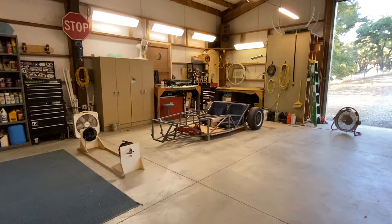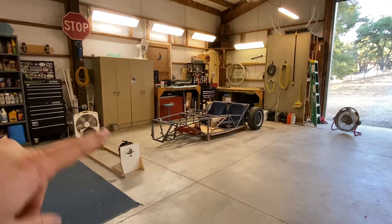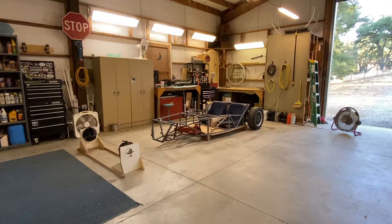This thing's been sitting for four to six years, basically just like it is. The front suspension needs to go next. The seat is kind of put in there so I could figure out where the shifter goes so I can position the engine, but I can't really throw the engine back in until I finish the front suspension. So I made a jig that holds the uprights, put them up to the frame, measure it, get it perfectly positioned at static ride height, and then weld the control arms together.